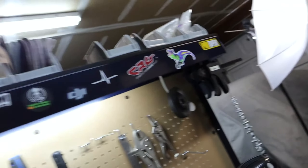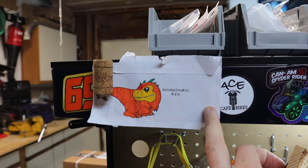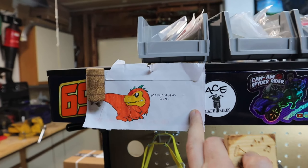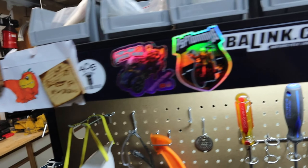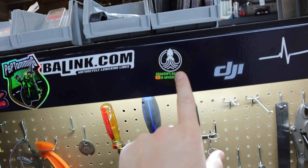As you can see the bike needs some work. I just wanted to drain the fluid and see if I could get it to work without buying any parts, but clearly I need to do some work on the clutch. The first thing I'm gonna do is replace everything on the master and slave cylinder since that's usually the problem child. It's about 20 bucks for a full rebuild kit. If that doesn't work, we'll go to the clutch basket and replace all the plates.